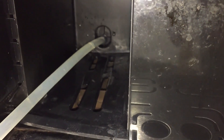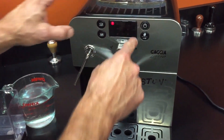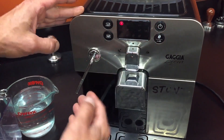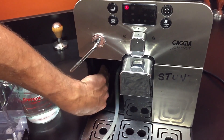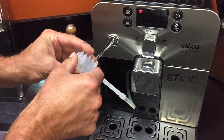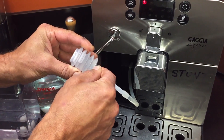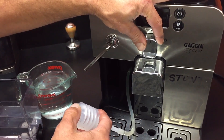Now what we're going to do is — the machine may have some air in it, but when you turn the machine on, I'm going to put my hand over the sensor. It's going to get ready. If the pump goes on, squish this bulb until the water gets sucked in. You'll notice the bulb will compress down as it sucks the water. And when it does that, immediately turn the machine off.